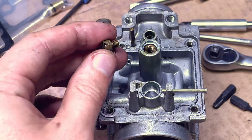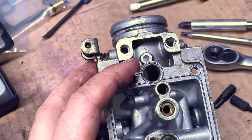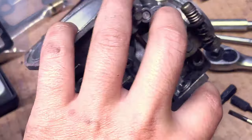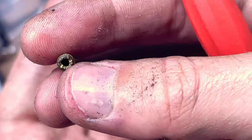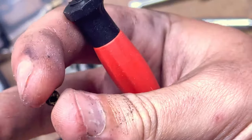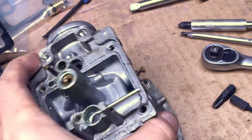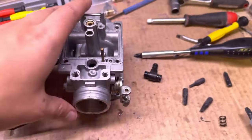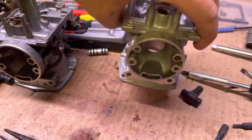After that I removed the main jets — I also removed all the components in the cage area as well. Forgive me if I'm getting some names wrong, but I at least removed the pilot jet and the main jet and cleaned those up. They weren't really clogged or anything that I could see, but they looked a little bit nicer after going through the soda blaster.